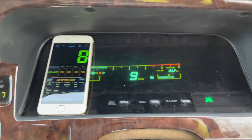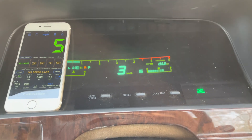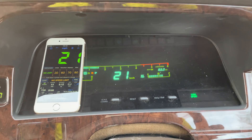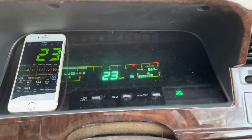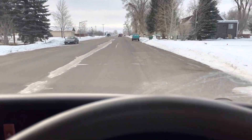I'll show you how it compares with my GPS speedometer on my phone, just to confirm it's actually reading miles per hour instead of kilometers per hour. It's a little off because I have bigger tires than stock — it'll read about one mile per hour low at the low end, then two around 50, and three to four in the 60–80 range. But it's pretty accurate in town at 25 mph. This little device is pretty sweet — I highly recommend it. No more guessing what kilometers per hour equals in miles per hour.